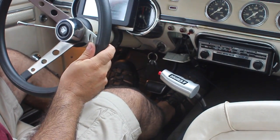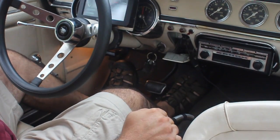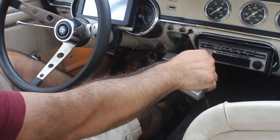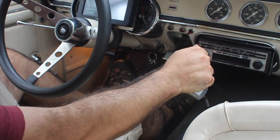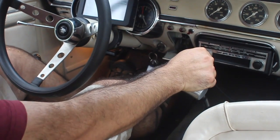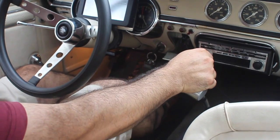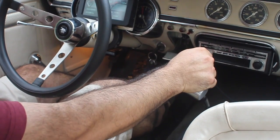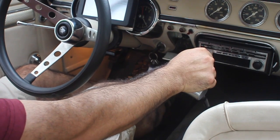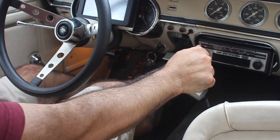You can hear the gear whine. So if you take your time between gears and sort of let the RPM drop a little bit, there really is not a lot of gear clunking going on — it's actually quite smooth. The best thing I've found for coming to a stop is to simply just let it roll to a stop, put the clutch in, and keep it in gear, which keeps the counter shaft from rotating.